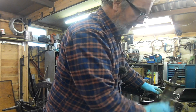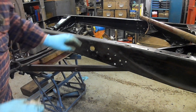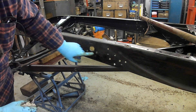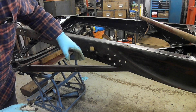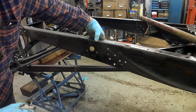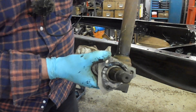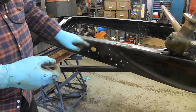Now on a 32, the three holes are arranged with one hole at the top. On a 33 or 34, two holes are at the top and one is at the bottom. What's important is you see that hole there is very close to the edge of that frame. What's very important is that you have a radius on that corner so you're not fighting with it.